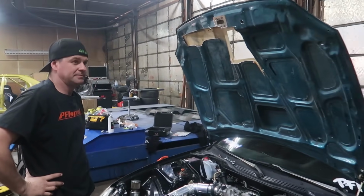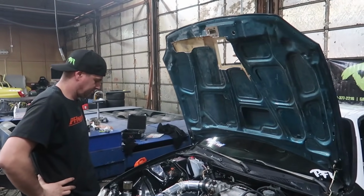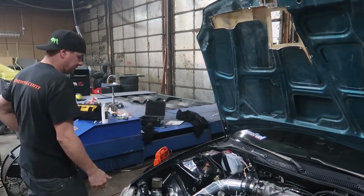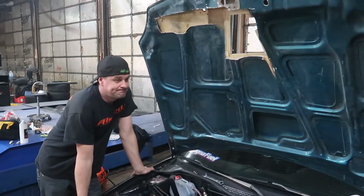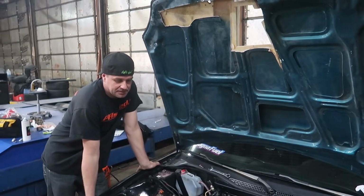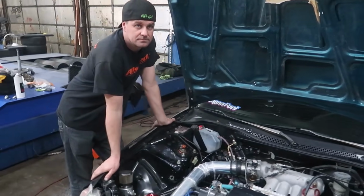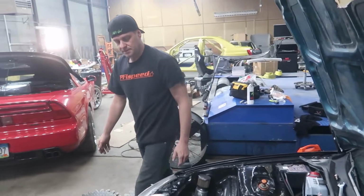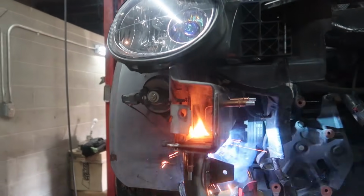I mean, it is what it is. I'm at 95%. System's tapped out for whatever reason. Well, we pulled the injectors again because the fuel pressure's not dropping. I don't see that being it. Injectors could definitely not be what he thinks they are, though. You could flow them and see. Me and Brent have been over on the dyno.